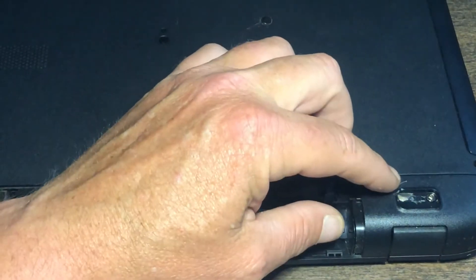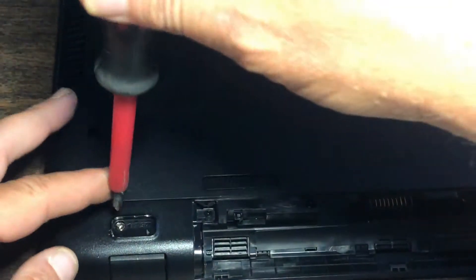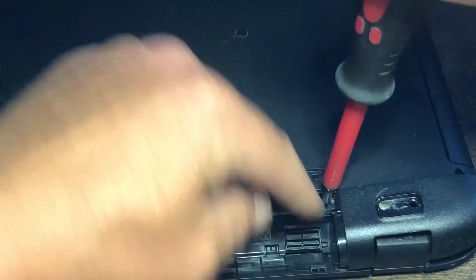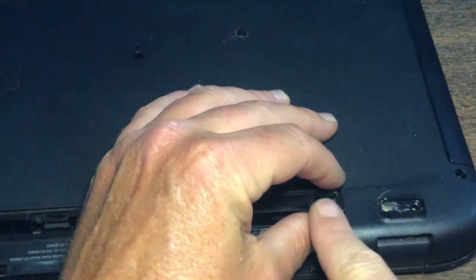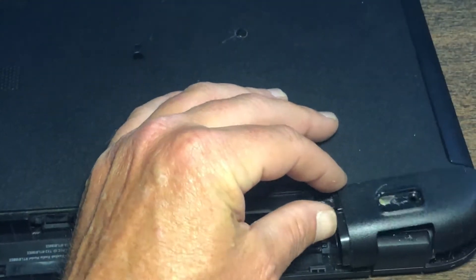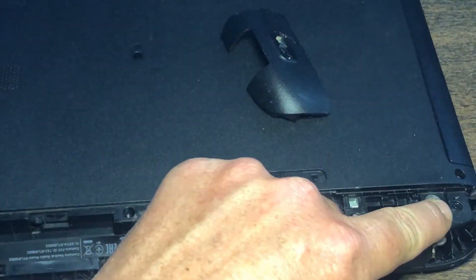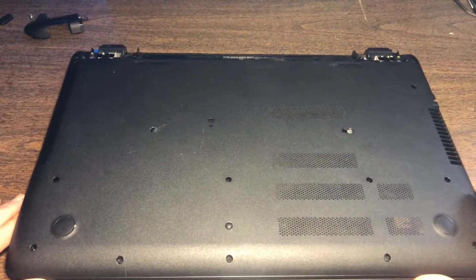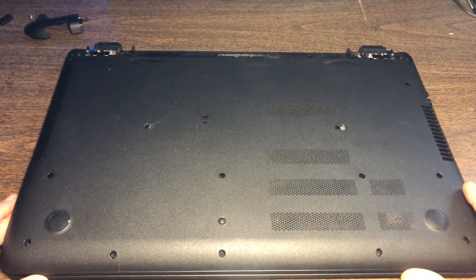Turn this around real quick. There is one screw right here, same thing over here. Here are the other sneaky screws — one here and one on the other side. Once you get that off, one screw here, one screw here, and it lifts right off. I'm going to point out all the screws you need to take out of this laptop before you can successfully begin to remove the cover.